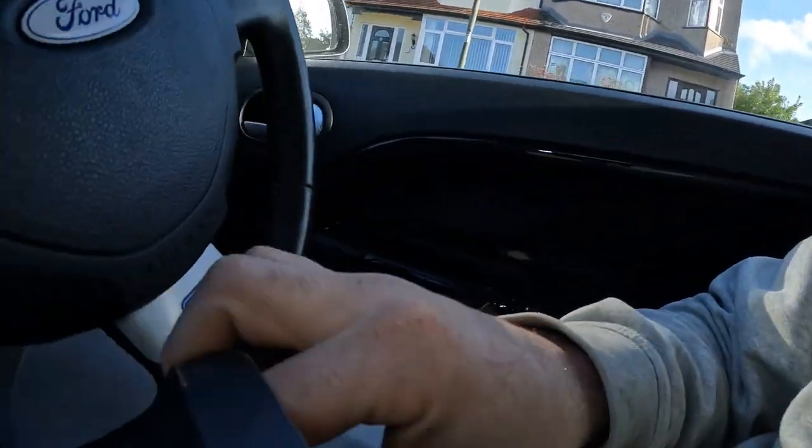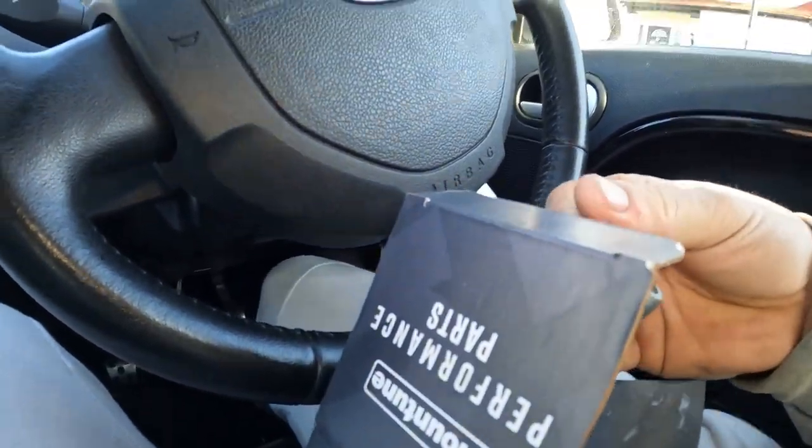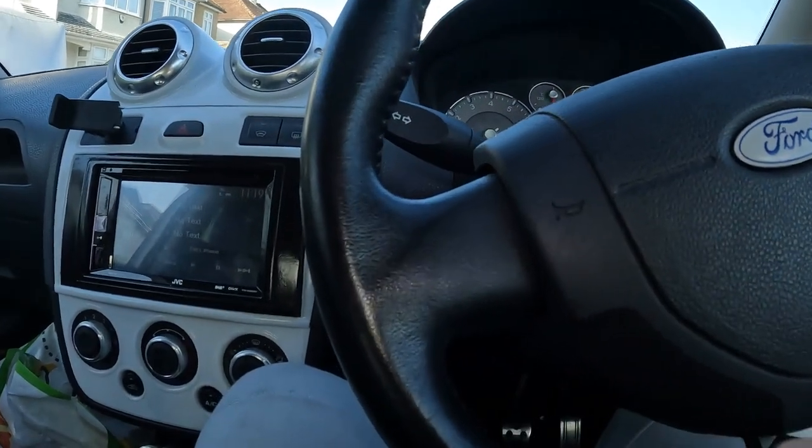So as you know, these shifter arms are made for the Mark 6 and Mark 7, so they do come with different size ball fittings. So I had to ring up Mountune, get them to send me one through of the larger diameter, but we really wanted to drive the car, so we did what we could to make it work. I'll just quickly show you, this is just the old Mountune box that it came in. But what we had done is, this was the old fitting, we covered it in electrical tape. I know it sounds like an absolute bodge, and then if I just fit this together quickly, we used an old rose joint.